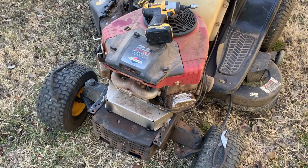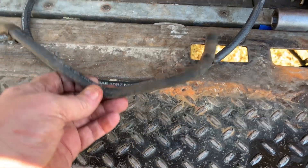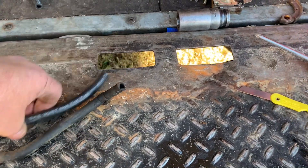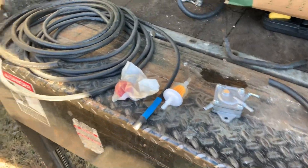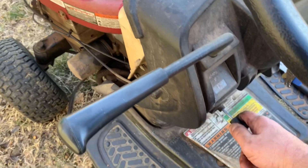This stuff gets used commercially out here at one of my facilities. These fuel hoses are molded this way from the factory, but don't worry about that — just stretch them out and cut them to about the same length. My work order didn't even call for fuel lines and a fuel pump, but since we're here and we see that it's leaking, just go ahead and replace it.